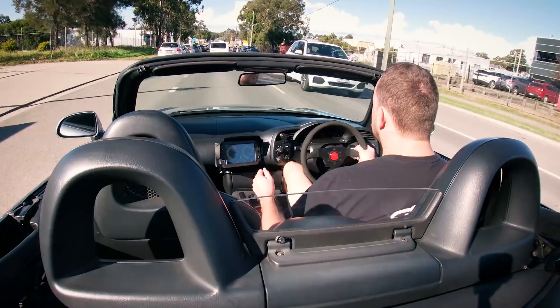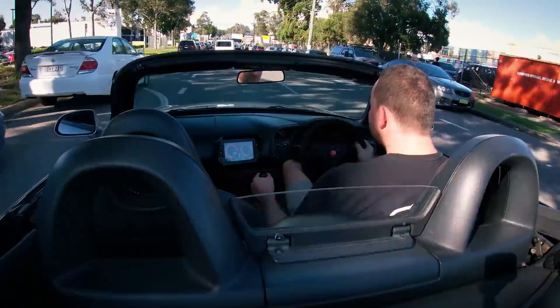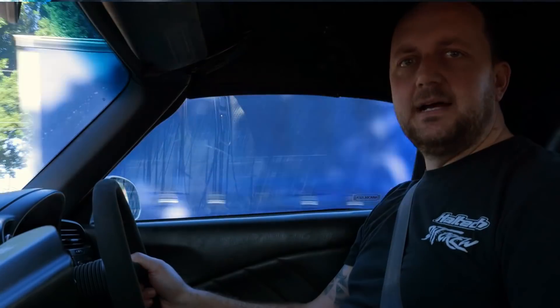This thing has the K24 engine — the 2.4 litre. It's lost some revs up top, but let's be honest, how often are you pinning this thing at 9000 RPM? The F-Series does sound awesome there. But with the K-Series in this thing, it's got grunt. We didn't need to do a stroker kit on the F20, we didn't need to do anything like that. Just got the bottom end out of a family sedan, put a K20 cylinder head on it. Here we are.